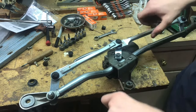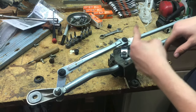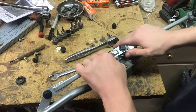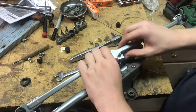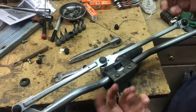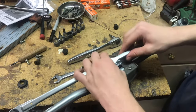So if you're going to line this up, you just take the motor, plug it back into the car, cycle it so it starts in its home position, then line it up from there. I need to move the motor separately from the linkage. So once I break that loose, I'm going to take the motor, spin this around to the position that I need — the 180 — but the motor is not in its home position right now. So I'm just going to take it over to the car, plug it in, home it, and then we'll bolt it together.